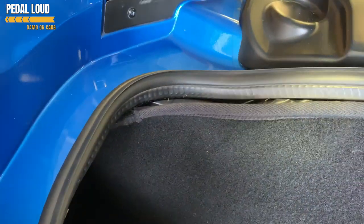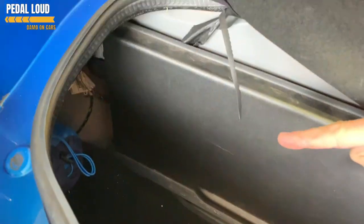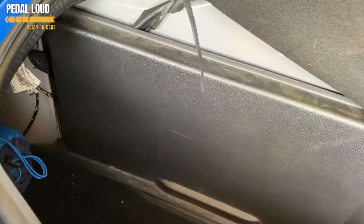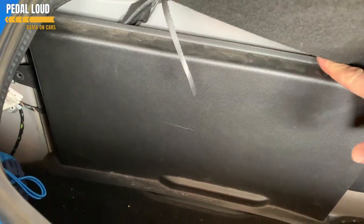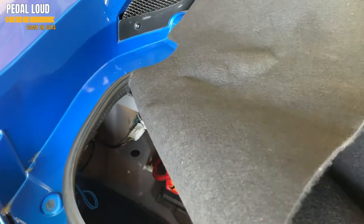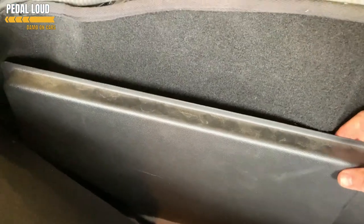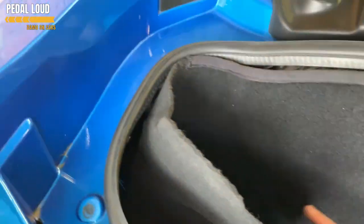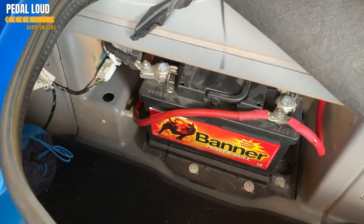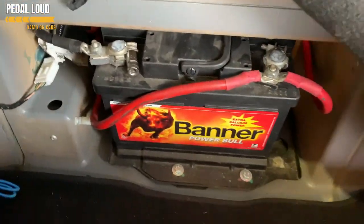It's always a good idea to disconnect the battery before doing any work. The battery support is behind the carpet. What a lot of people do for ease of access is remove the plastic battery panel - it's held on with three little bolts. A lot of Lotus owners mount the plastic on the outside and cut the carpet out for easy access, since many don't use the car every day and like to put trickle chargers on them.